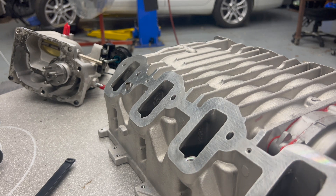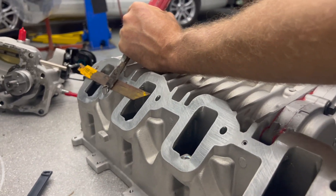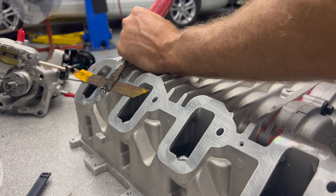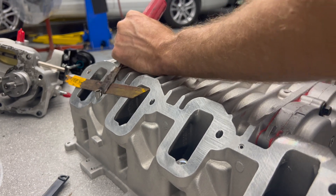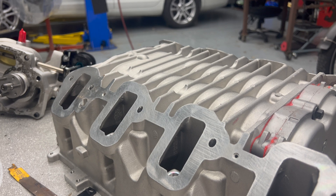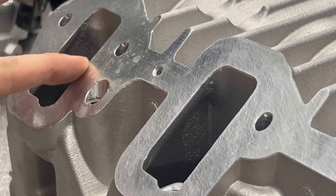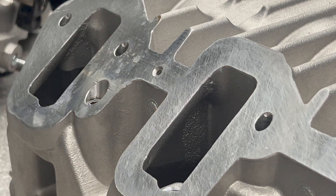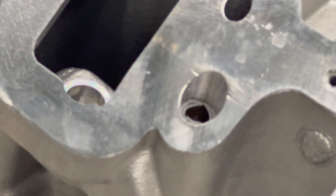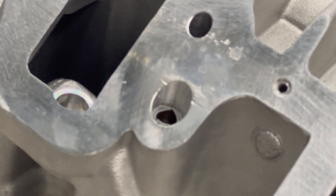I'm being careful not to mess up the supercharger — I put some tape and a thin piece of metal down as a buffer on the mating surface. It took a little force but I got it. One little indent there, but the gasket will cover the sealing surfaces around the ports. No metal shavings and the dowel pin broke off below the surface, so we won't have to worry about it hitting anything down there.